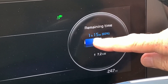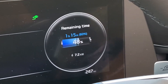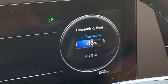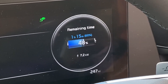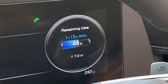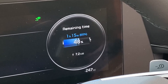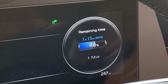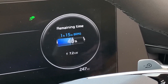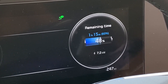It says one hour fifteen minutes and it's charging at 7.2 kilowatts. It's a good idea to charge to 80% maximum to prolong battery life. The manual says keep it between 20 and 80 percent for local running. If you do a long run, take it up to 100% — that's fine — but you shouldn't leave it fully charged for a prolonged period. I've decided to keep it between 20 and 80 for local runs, and charge fully the night before a long journey.